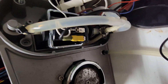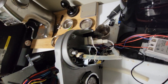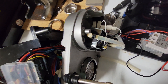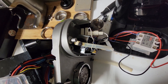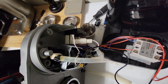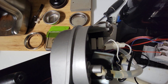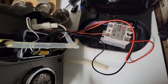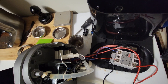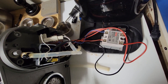I hope this is somewhat helpful. It's not super complicated — we just need to make sure the wiring is correct, and there are a lot of wiring diagrams out there. With the all-in-one PCB it does simplify things so you're not running a spaghetti mess of wires everywhere. The biggest challenge is really just wire management — bundling wires and getting them out of the way so they don't interfere when you put the housing back together. The Gaggia Classic and Classic Pro have a lot more space inside, so you could possibly fit the whole board inside the casing rather than mounting it on the outside.